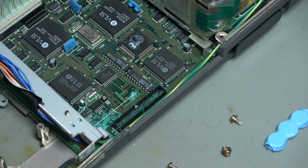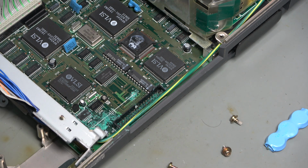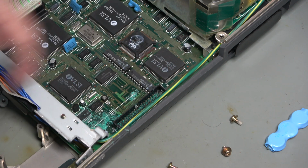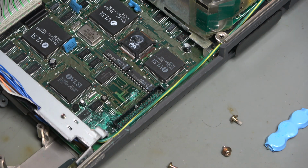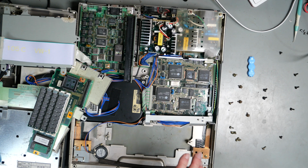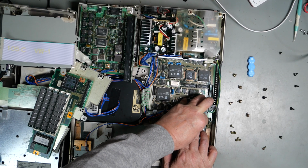It just came off. So yeah, it doesn't seem as bad as the 286. The 286 had a lot of damage going all the way down the board. This seems to be localized here. It's obviously got into this floppy connector. So we're going to have to take the board out and have a look at the bottom. But to start with, we can just put some vinegar on here and neutralize the acid, or the alkali rather, and basically stabilize it so that we can then work on it later. I'm afraid we're going to end up disassembling this completely and taking this board out,